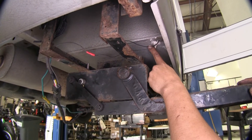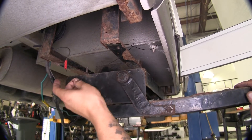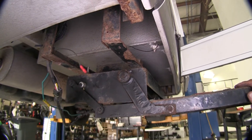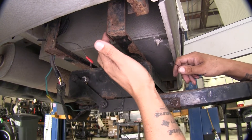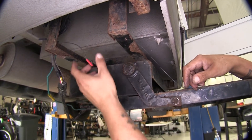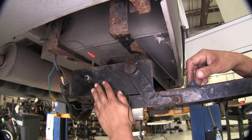If we follow the wires down it'll lead to the floor and they're going to come out right here. I can go ahead and pull my wires out — one of them is going to be attached to the frame here with a self-tapping screw for a ground, and the other one's going to be connected into our harness that connects to the motor for our steps.